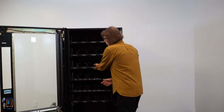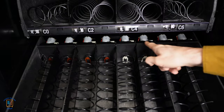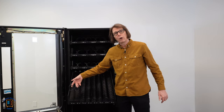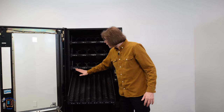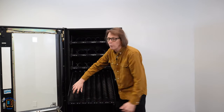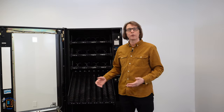If we slide out the candy tray on our D tray here, we'll notice that we've got eight selections on this machine and eight vendors on the back. For the D0 selection as well as your D1 selection, one is a clockwise and the other is an anti-clockwise turning helix or spiral. By using the couple motors feature we can marry these two selections or vend motors together so that when D0 is pressed, both motors will turn, delivering the product. This is how we can convert this selection over to a chip selection.